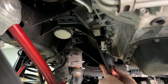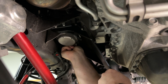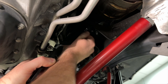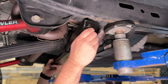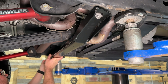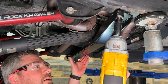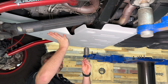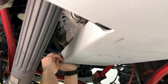Next we'll install the forward mounting brackets, which simply bolt to the existing mounting studs found on the factory motor mounts — one on the driver's side and one on the passenger side. Keep this hardware loose until all of the skid plates are installed, then tighten everything down at one time. Next install the new cross member for the skid plate, making sure the widest point is towards the front of the vehicle. You can use the new provided hardware or reuse your factory hardware if it's still in good shape. Then lift the engine and transfer case skid plate into place and secure it loosely — three bolts go through the skid plate into the new cross member with one bolt at the front on each side into the new mounting brackets.